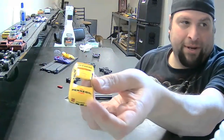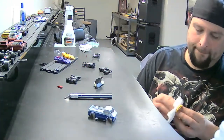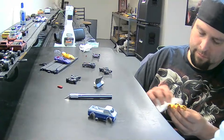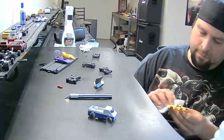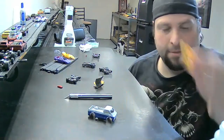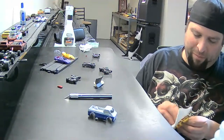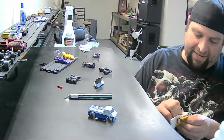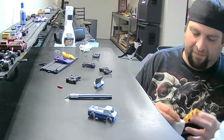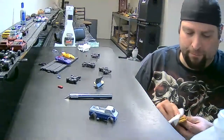So let's do the hood here. It's got all the big decal on it. This is just the rubbing alcohol going at it. And what would that take? Maybe 30 seconds? All gone. Beautiful. So it won't be showing through at all when we go to mask and repaint. That's the whole idea here: if you can't get it all off, is to break up the hard lines or the hard edges of the paint, the thick spots of the paint that would bleed through normally.